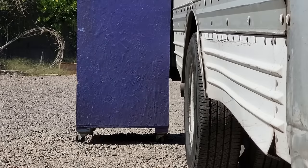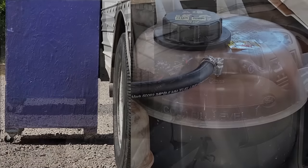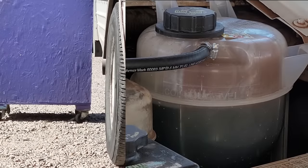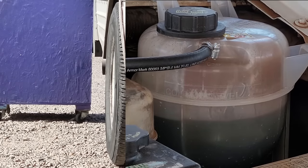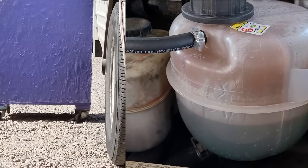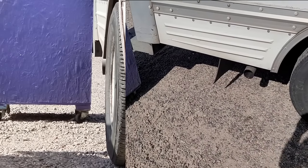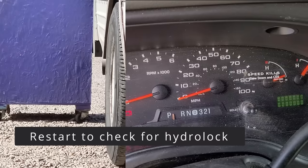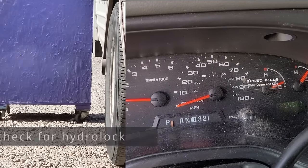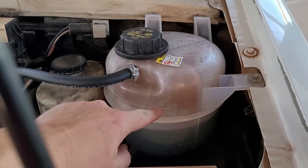The steam seems to be getting worse as pressure builds in the radiator system, forcing water into cylinder number seven on the driver's side. We're 13 minutes into our test and temperature is just barely off the cold mark, so no overheating issues. We've got 10 minutes left of our run. It's been just slightly over 50 minutes and temperature is fine — we're not overheating. We're basically at the end of the test. I've still got steam coming out of the pipe but it's significantly less.